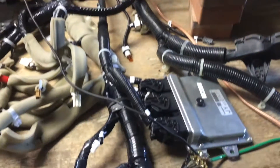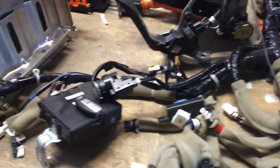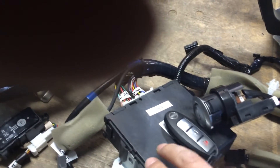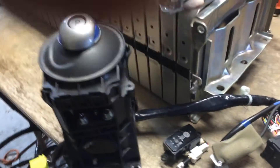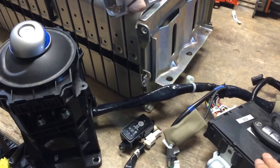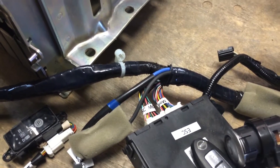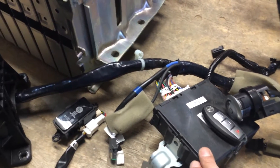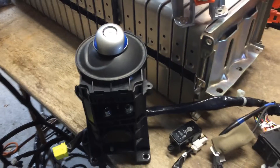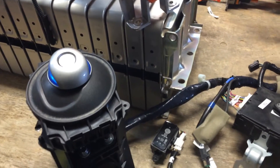Over on this side we have the VCM, the power button with the NATS antenna on it, the key shift controller, and the actual shifter is still here. The shift control box is a CAN controller — there are a lot of wires going in and out, so it could be possible to emulate with something else but could be quite tricky. The shifter itself would probably be more straightforward, although from what I've been able to tell it's not as easy as one switch per gear position — it's encoded somehow.